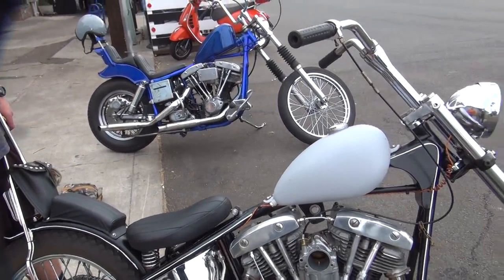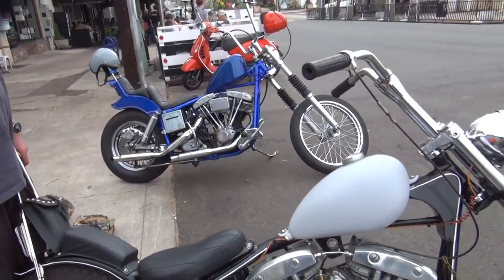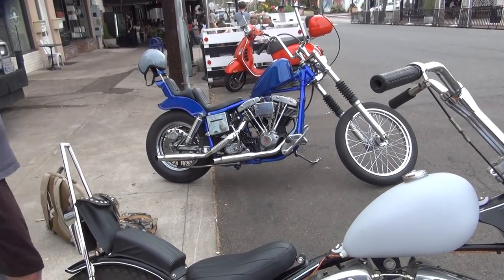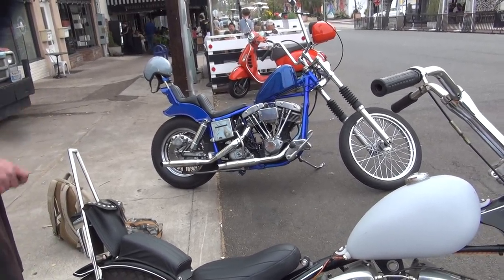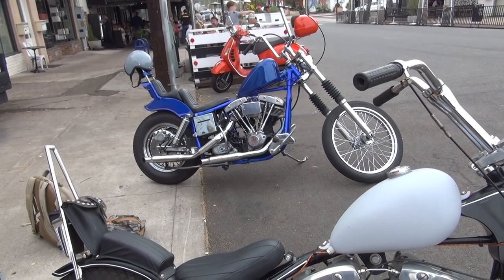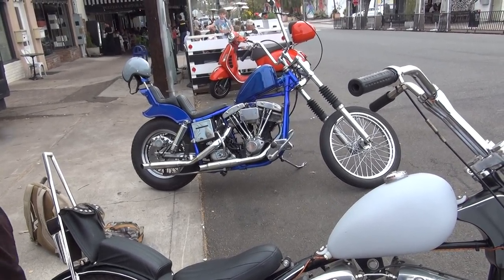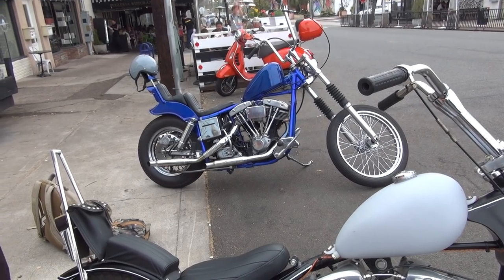It makes starting off from a stop hard. You have to really get on the gas for a smooth start. What jet do we have on yours? What jet's in that one? We changed it. A 72 and the... What was our low speed? A 268 was in it, or no. And then you gave me the 231, and I needed to put that in. I wrote it in there, but...